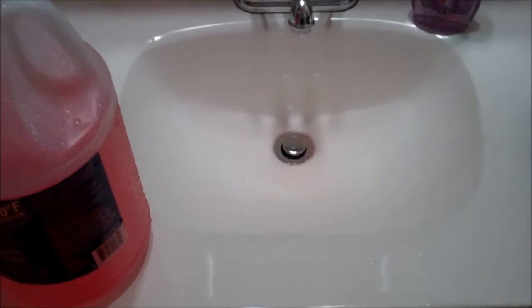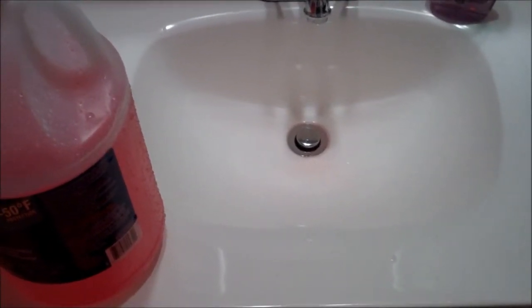Put about a half gallon in each one. Buy this stuff in the States, it's about half the price. The RV antifreeze. I put about a half gallon in the bathtub and a quart in the sinks. In the toilets, I have flushed it. I have held the stopper up so to get all the water that's possible out of the toilet out.